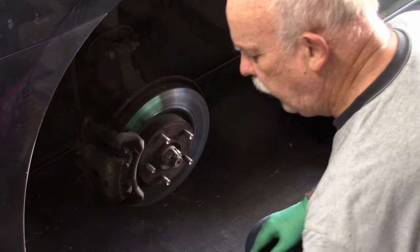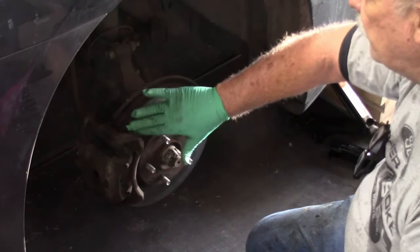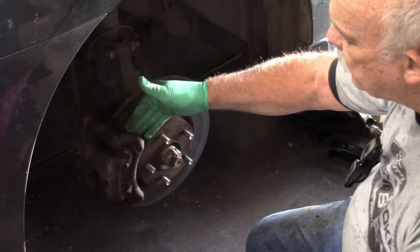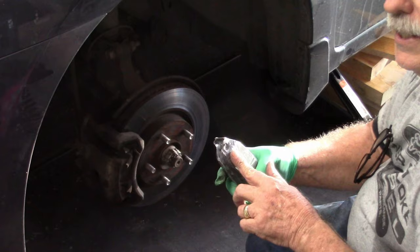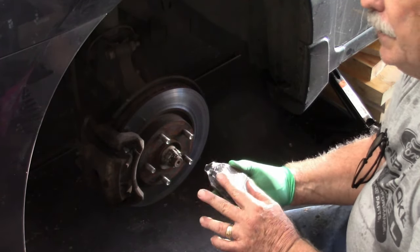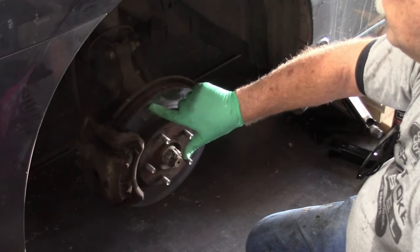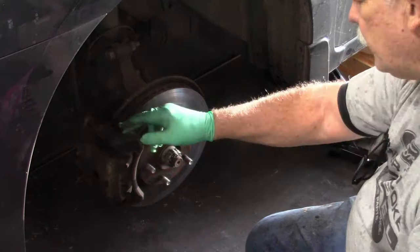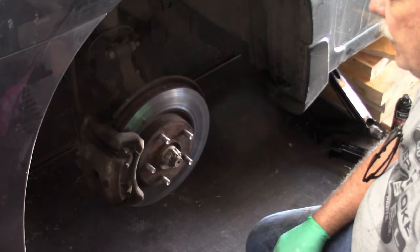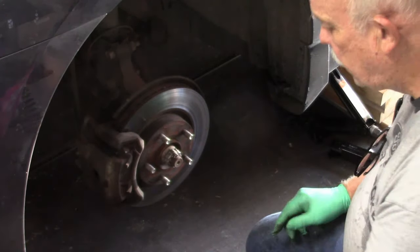Sometimes the organic material of your brake lining will become a dust over time and it'll settle. As the rotor spins and meets the top edge of that brake lining, it's going to form like a snowball effect — it'll build up a little crust. That crust becomes glazed, and that glaze is like your wet finger going across fine glass: it's going to cause a squealing. So I try to sand them down a little bit to help avoid that.